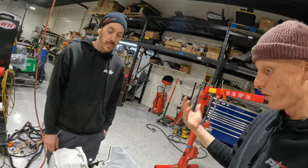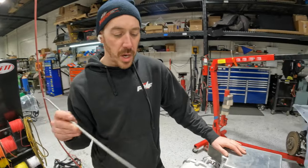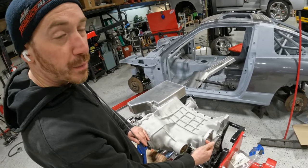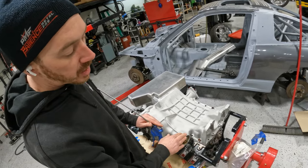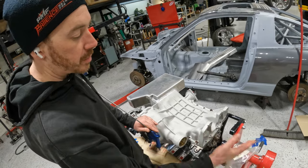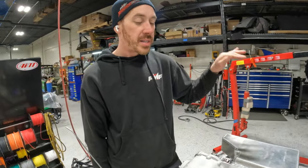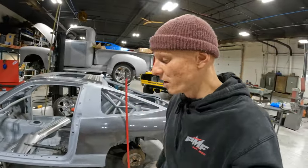Where we go from here is we just need to mate the transmission up to the oil pan. Due to the all-wheel drive adapter flange, we just need to come in and elongate the four bottom holes of the transmission to get those to mate. While that's out, I have an OS Giken triple plate clutch we'll put in there. We'll assemble the trans and get it back in the car for mock-up, then essentially jump right into the hot side and start building a manifold. Just like that, the momentum on this car is back on.